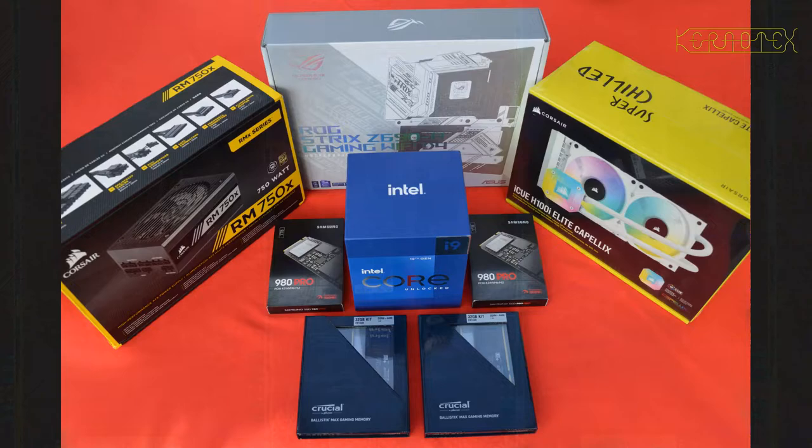When Intel brought out this chip, the reviews were very good and I thought this was the one for me — I know how reliable Intel has been. The killer factor for me was the single-thread performance of 12th gen Intel. Looking at CPU benchmarks, I think it's cpubenchmark.net — it has a rating of over 4000 for a single thread, whereas the fastest AMD, the 5950X, is around 3500. That's about 20% faster. Basically this CPU has the fastest single-core rating on the planet for an x86 processor, and that's what did it for me.